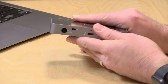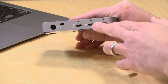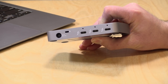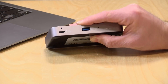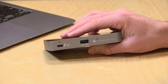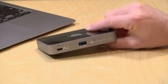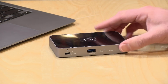What's really cool is that each port behaves like a traditional Thunderbolt port — you can plug a monitor or two in and get display output, which hasn't been the case with many USB-C ports on docking stations we've reviewed. You can essentially roll your own dock with this thing. The price is right, the flexibility is good, and it's been rock solid and stable throughout the week I've been using it. I'm very comfortable recommending this, especially if you need more Thunderbolt ports — just keep in mind the shared bandwidth limitations.